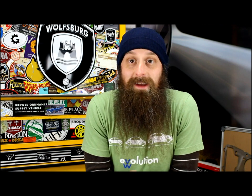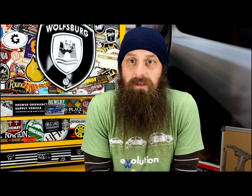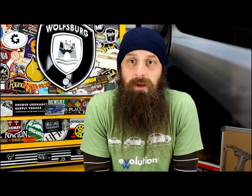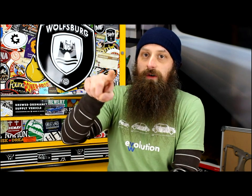So what are the main things that I use it for? Checking faults, resetting maintenance lights, and actually graphing out measuring value blocks. Measuring value blocks are the information that the ECM sees that we can go in and look at. I have a little bit of a video capture doing some of this on my car that you'll see in a minute. These values that you see, we can actually create a graph for using some software in Vagcom, and it's helped me a ton. It's helped me catch little blips of failures that you would never see in a change in a number — but as a graph line goes and you see it drop out and keep going, you notice it right away.